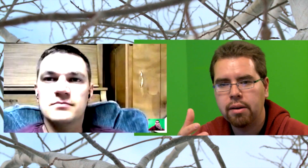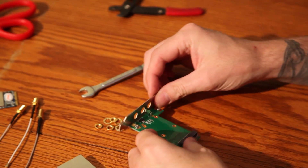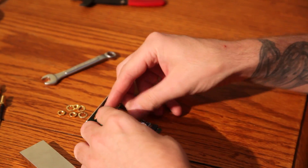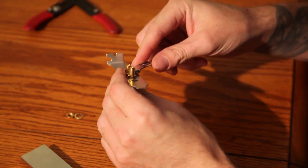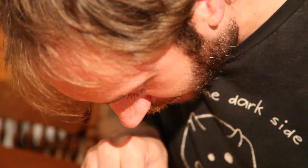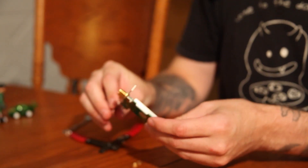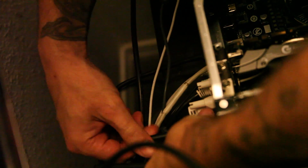You can get these for about $10 on eBay. And once you get them, it's as simple as disassembling the housing for the adapter card, putting in the mini PCI Express card, feeding the antennas the right way, cutting a little hole in the shielding, and clamping it all together and putting it in your Hackintosh. Boot it up, and it just works — you don't have to install or do anything. It's just automatic.